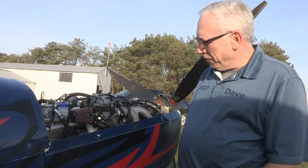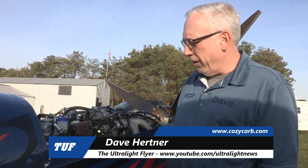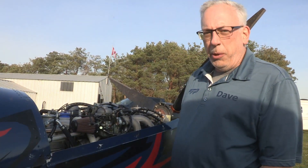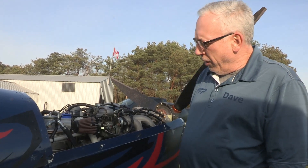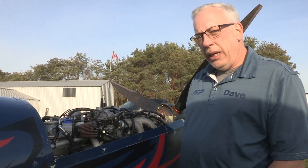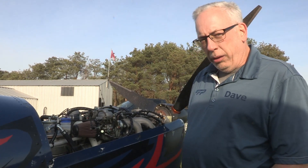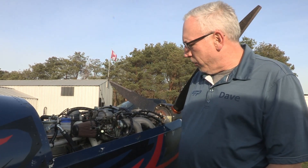Let's talk about something you're manufacturing for the engine. There are two different ways you can perform carb heat on an aircraft engine. For air-cooled engines you pretty much have to do a heat muff or an electrically heated carb body, but if you've got a liquid-cooled engine like the Rotax 912, then you can use engine coolant to heat the carb body.